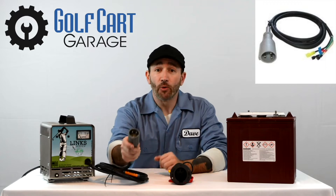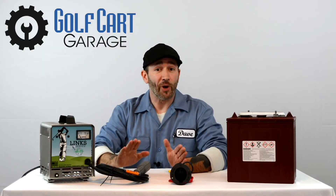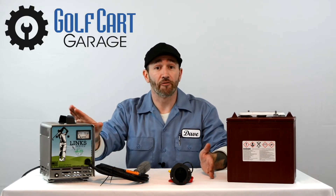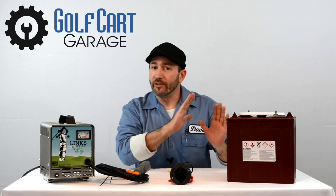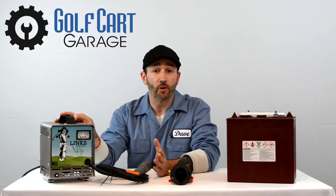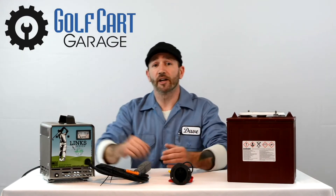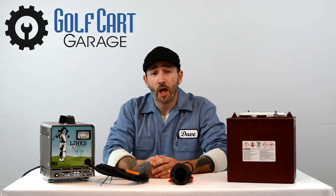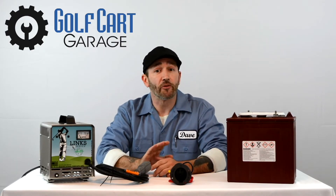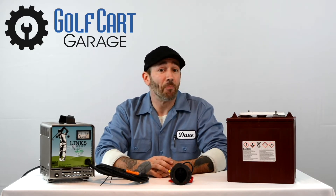Most chargers that have a round 3-pin plug like this one I have in the garage today are typically manufactured with no control unit or brain — because they rely on the OBC on your Club Car to give commands to turn the charger on and off when charging is complete. If your OBC isn't functioning or if it's not there at all, even a brand new charger won't work correctly if plugged into that receptacle. Some folks will replace the charger, the onboard computer, or both. This can get pretty expensive since each one is usually between $300 and $400, and could end up costing you time and money on returns as well.